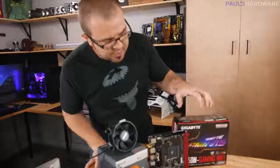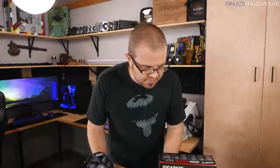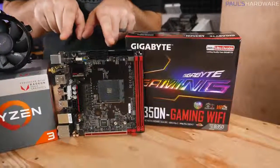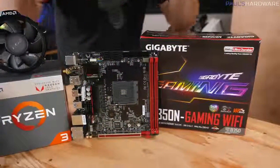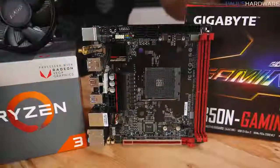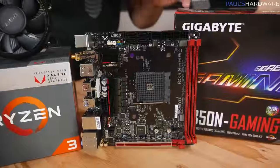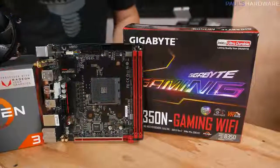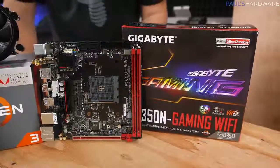There are eight main components to a desktop computer you're going to build yourself, starting with what holds everything together — the motherboard. This is a mini ITX motherboard, which means it's very small. Form factor is important: the mini ITX form factor is going to impact what case you choose, so if you want something small, mini ITX is the way to go, and we're going to be choosing a mini ITX case here in just a while as well.